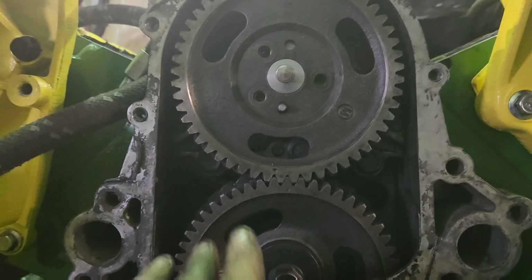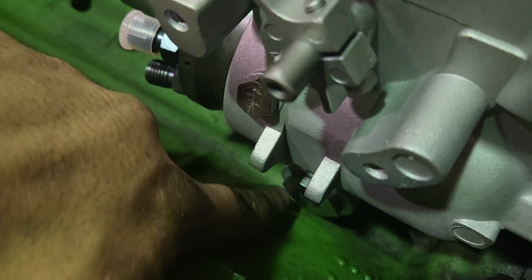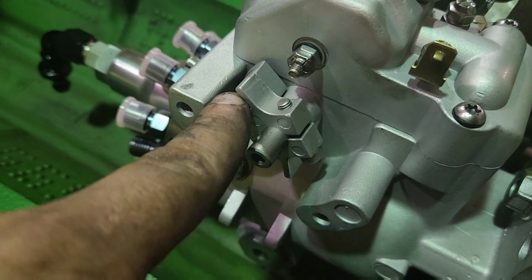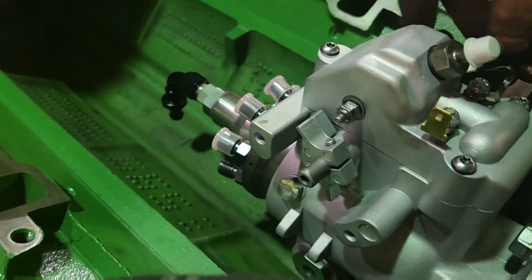So in this right here and down there where that plug is, there's usually a plunger or a rod right here and a lever, and it runs off of this guy when you turn your throttle. See, it's round on the bottom. As you go higher in the RPMs, it pushes this rod in, and that's for your dynamic timing. As your RPMs increase, it moves that rod in and the timing increases. I will actually walk you over here to a stock pump I have on this other 6.5 and show you what the rod looks like.